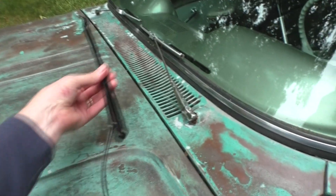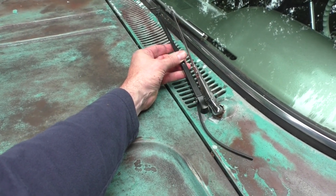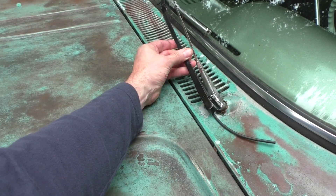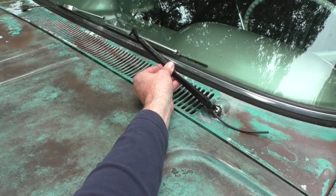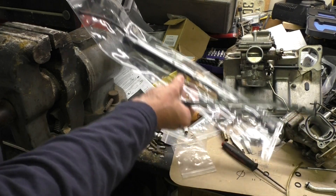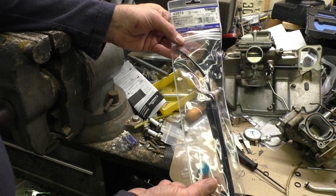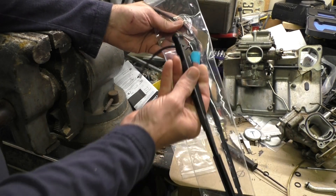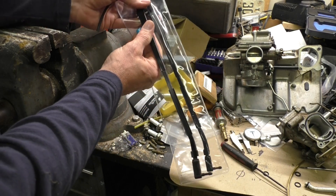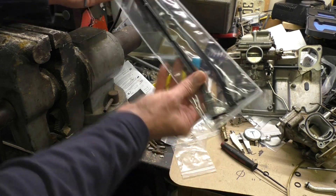I don't really want to destroy this new windshield - I've actually had them fall off when I've been using the wipers. So we've got a little bit of an upgrade we're gonna try. We're gonna adapt these wiper arms off of a Jeep Cherokee - they're actually for the rear. The Dorman part number is 428-73, and as I said it's a rear wiper arm for a Jeep Cherokee, I want to say 85 to 94.